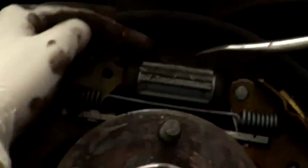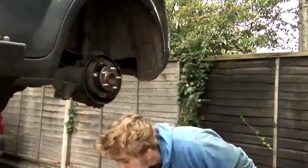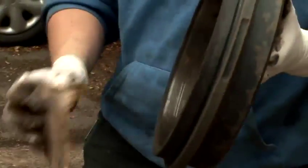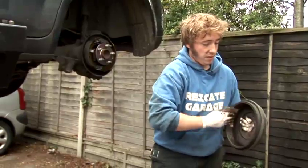And because it has a piston each end that pushes the brake shoes out, just need to push them back, just to check that they're moving around and they're not seized. They're okay. Now, this one only has a small lip, hardly anything at all, so I'm just going to take some emery cloth and just basically rub away anything that's there.